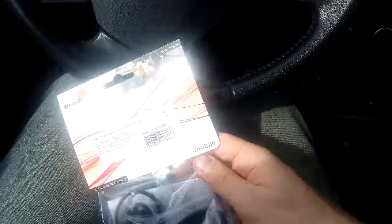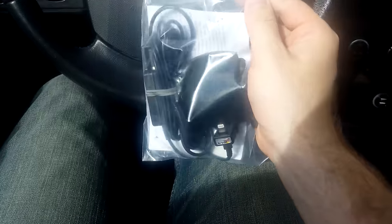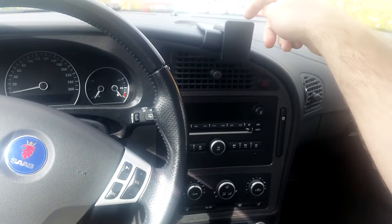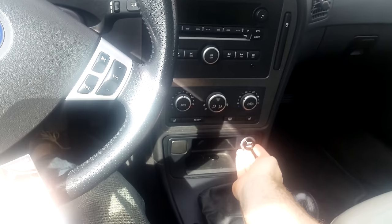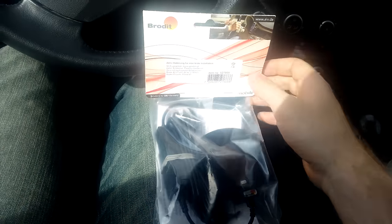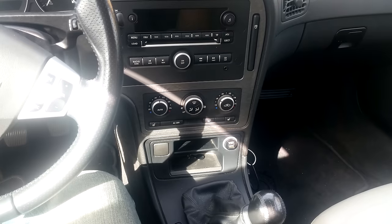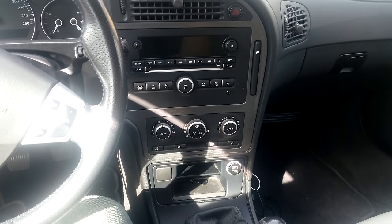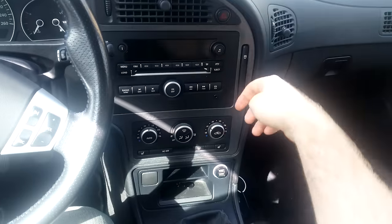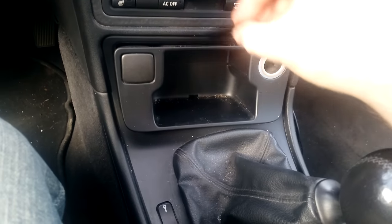And now for the hardest part. This is an active holder, which means that it has a charger for the iPhone. This cable here is a fixed installation variant, which means that there will be no loose cables or anything hanging around. We will route the cable behind and back behind the head unit and then steal power from this 12-volt outlet here. There's actually a small power converter which converts this to 5 volts for USB. The phone holder for the iPhone 6S with the mounting case is part number 527-666. Hopefully we can install the cable without removing the head unit for the radio, so I'll just try to remove this lower panel here. This plastic part just snaps loose — you remove all the loose parts and then use the prying tool again to just release all the little snaps around, and then everything comes out.